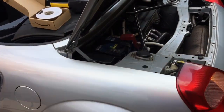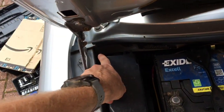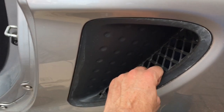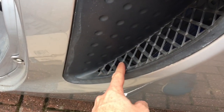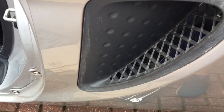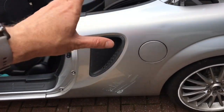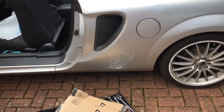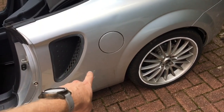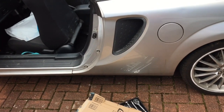For the power and earth wires, the power wire just connects to the positive terminal on the battery, then I ran it around and poked it down into the corner of the firewall, then I removed this plastic side skirt, pulled the yellow power wire all the way through, and then I found a black rubber grommet in the base of the frame, sliced into that with a utility knife and pushed the yellow wire into it, where it subsequently goes into the frame of the locker bin when the plastic liners are removed. I have a photograph from when I removed the rear guard for completely different reasons — I was fitting an aftermarket air filter — and that shows more clearly exactly where that black grommet is.